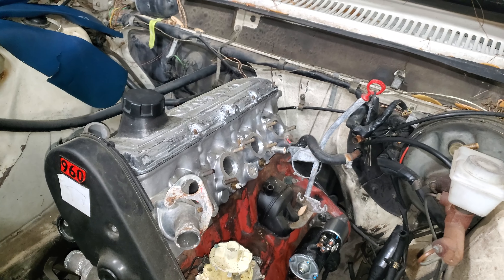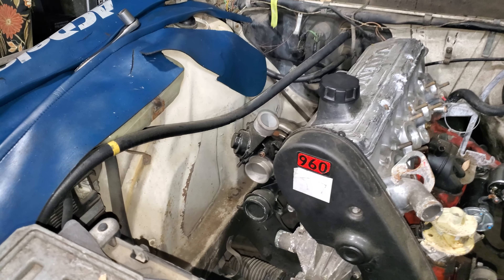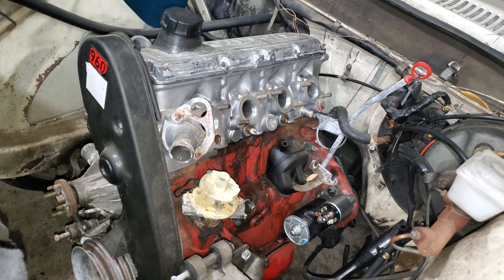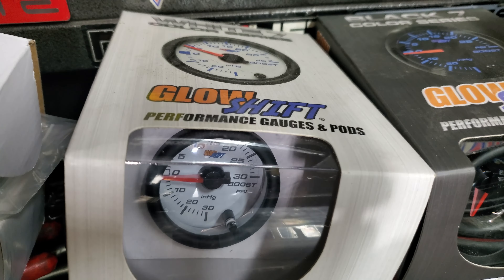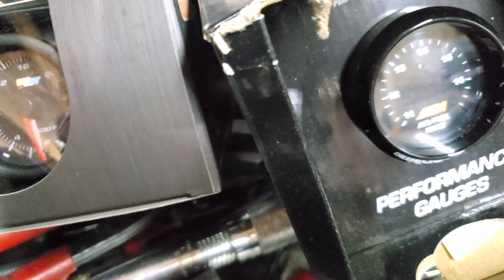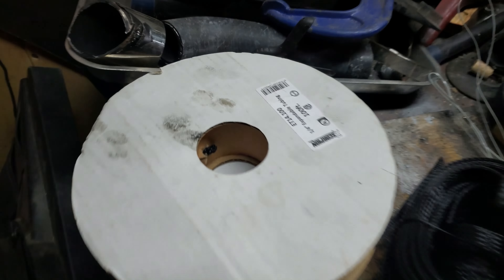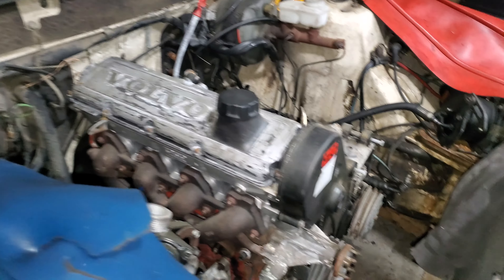We went through the motor, did all the gaskets, did a bunch of videos about it — we'll include them in the description below. How we got this far, the clutch we used, things we checked out, the manifold comparison on the exhaust side, head gasket and timing belt. This is a Frankenstein B230FT head on a B21F block with pistons, rods, crank, and a turbo. The goal was primarily just to run on E85 first, then upgrade the factory platform a little bit to make the car more efficient, more economical, and more environmentally friendly — running cleaner than it was with mechanical fuel injection, with little to no learning curve to change the fuel curve and ignition curve.